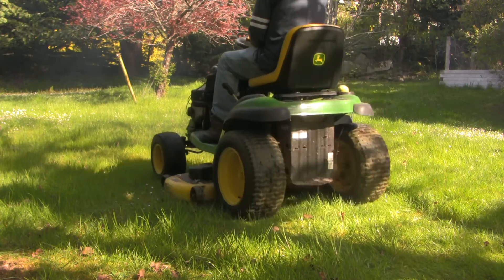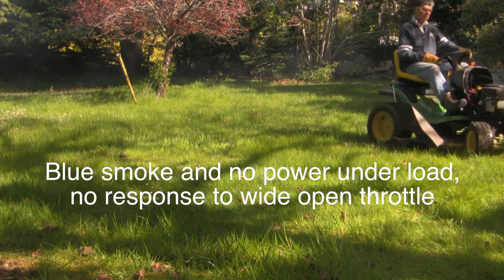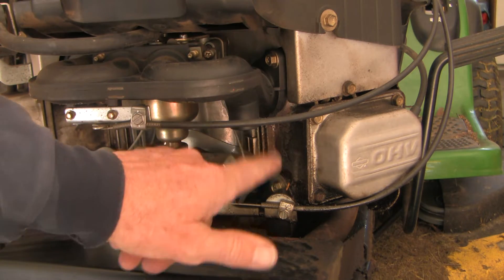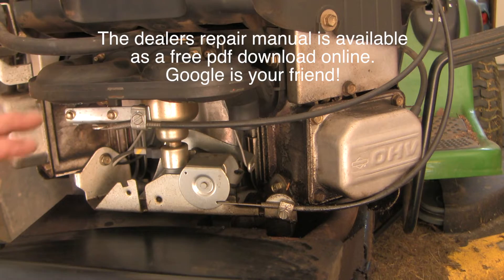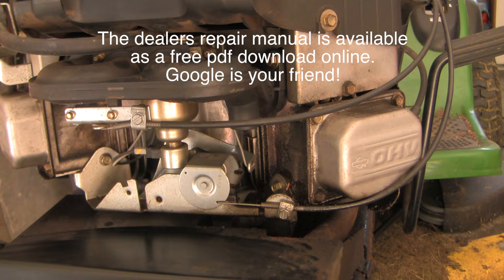Let's take it around the garden and see if it's working. When I examine the engine, the only significant abnormality I'm finding is a little bit of oil discoloration around the left-sided valve cover gasket, which is likely from a leaking valve cover gasket seal. But that doesn't explain our two problems of poor performance, poor engine power, and a little bit of bluish smoke more than you'd expect. The blue smoke has been going on for a while so it may be an unrelated issue. The first thing that comes to mind in a vehicle that's been sitting so long is whether there's dirt in the carburetor affecting the amount of fuel going to each cylinder — if one cylinder is getting way too much fuel, we've got a problem.